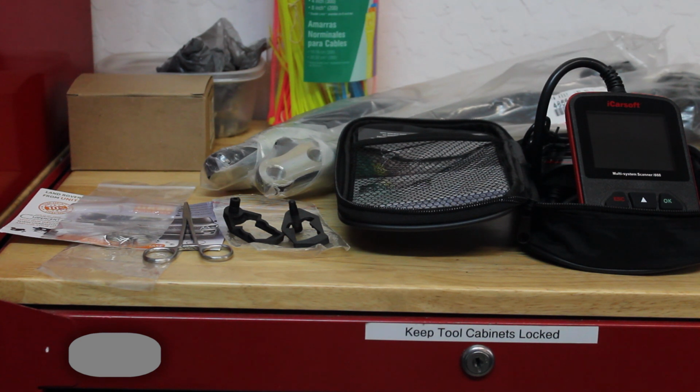In the meantime, I'm going to pull the door panel off. I'll show you that real quick. And I wanted to mention that the door has airbags in it. Anything with a yellow cable or yellow wire, don't connect or disconnect with the battery connected on the car. If you need to do anything with the airbags, you have to disconnect the battery and let it sit for about 10 minutes. Otherwise, you can create a big problem. So never touch the yellow cables. Those are for airbags only and for the safety system. So don't touch those, and I'll get started here in a second.